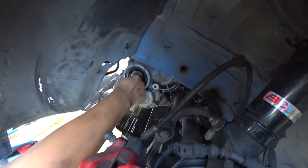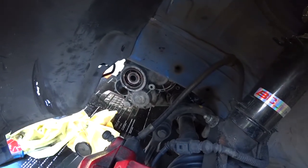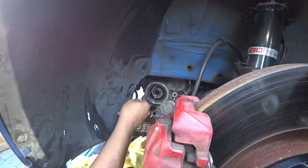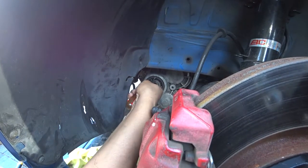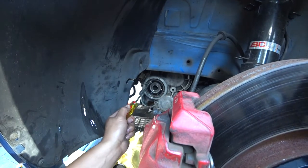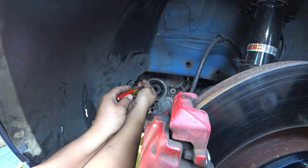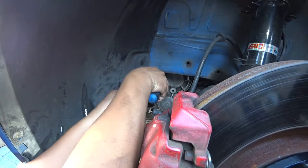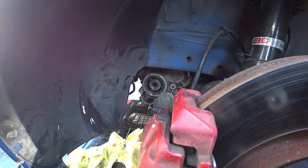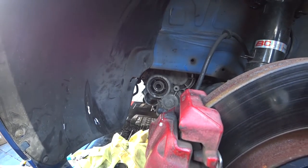You'll see that play? That's actually natural apparently on a six-speed tranny on a Mark IV. So this shim actually stops that chatter. There's a little clip on the inside you have to pull out. You guys see how that spins around? It has to be pulled out — the trick here is to use two flatheads and pretty much split it and then pull the clip out. Give me a second here to see if we can find a way to do it quickly.